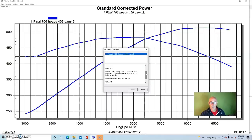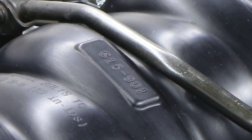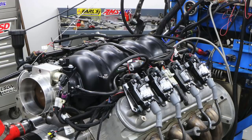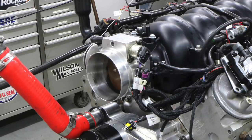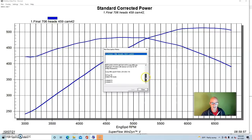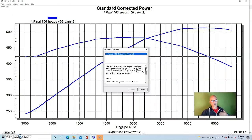We also installed on both Cathedral Port heads — the 706 and the 799 — a Dorman LS2 intake manifold, which is basically the same functionally as a Trailblazer SS intake manifold, just lower and fitting different spots. It's a fairly good intake manifold, not quite what a Fast LSXR or LSXRT is, but it makes as much as a Trailblazer SS. We also ran a 92 millimeter throttle body, all managed by a Holley HP management system, with 1-7/8 inch headers on all combinations. We optimized air/fuel and timing on all of these — about 30 degrees of total timing and an air/fuel ratio right in the 12.8 range.